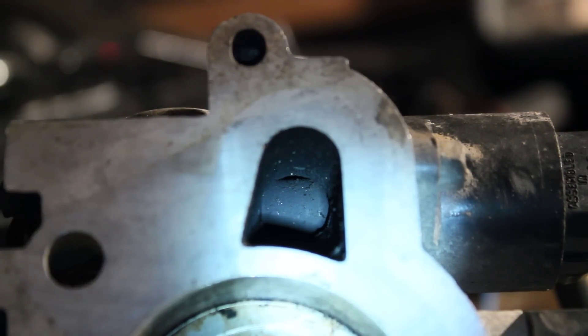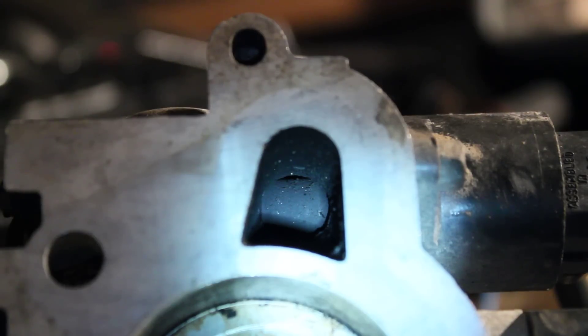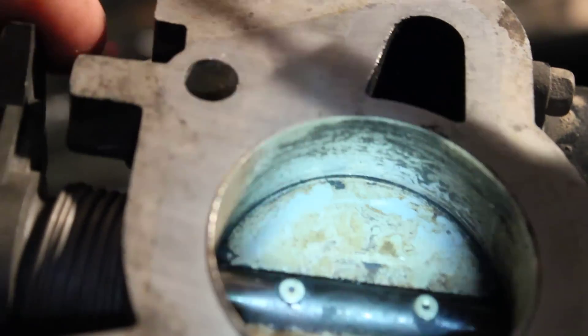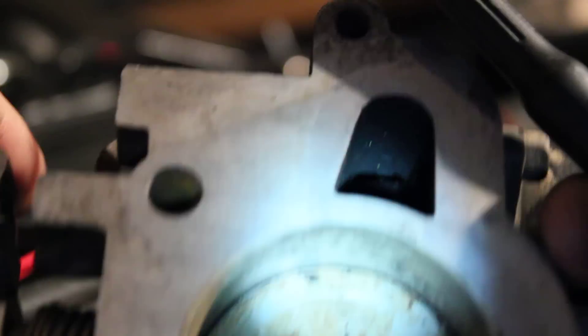In cool mode, or if I'm trying to warm up, this valve will be open a lot more — it basically creates a leak or a way for air to seep in past the throttle body's blades, which are opening and closing.